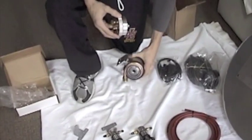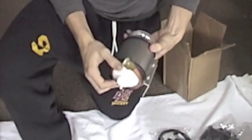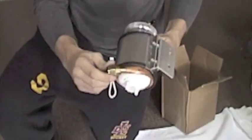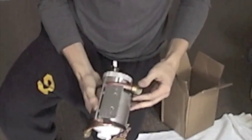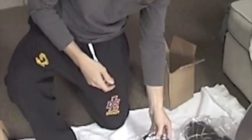What you've got around the filter is copper tubing. Coolant from the engine routes around and through that tube — you need to bring the grease up to 140 degrees Fahrenheit for the correct viscosity, otherwise it won't burn right. So that's pretty much the components. Besides that, there are some electrical connectors that we'll get into later.